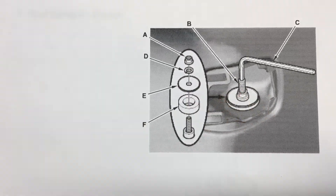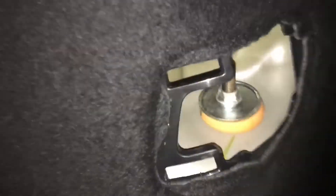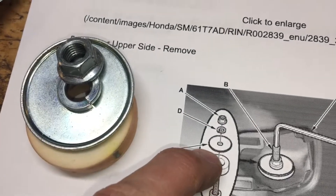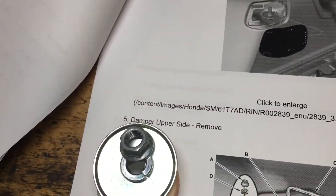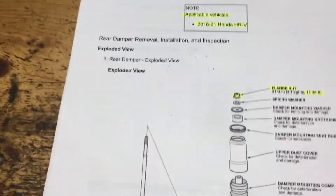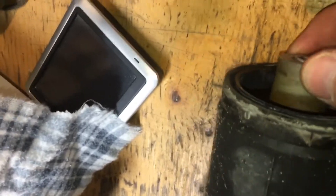You can see here's the stack. You can hold the internal hex with an allen key and spin it off. There's the stack — I've kept it in order so you can see it in reality: the nut, the spring washer, the damper mount washer, and the damper mounting urethane. These two components are clearly still in situ. You can see the rubber bushing and the steel bushing inside — I'm going to leave that as is.